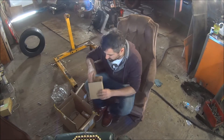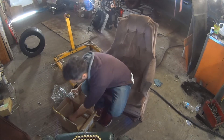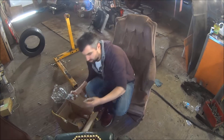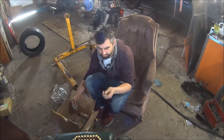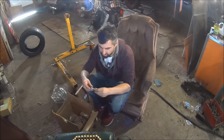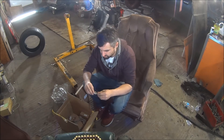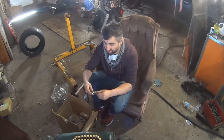This is what I wanted to show you. This one's opened up because I was checking it out when I was in the truck. It comes with all the stuff you would think you would need. This is the T so you can go off your oil pressure sender - you basically thread that into the block, take this off, and then you put your MPT sender unit, so either a low pressure light or for your gauge.